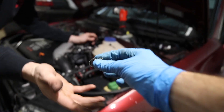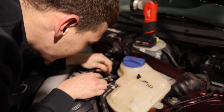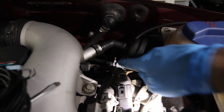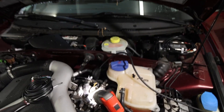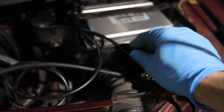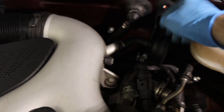Now we can cut the line somewhere closer to the grommet and send it. This is some professional zip tie work. We got the boost T from the AEM gauge there, with the boost hose going off of it, and that goes through there. We have to put the wideband sensor through as well. We cut two notches in the plastic to the ECU — this guy slides through one side and this guy slides through the other. Boost is connected down there, back into the T. Everything else is inside the car.